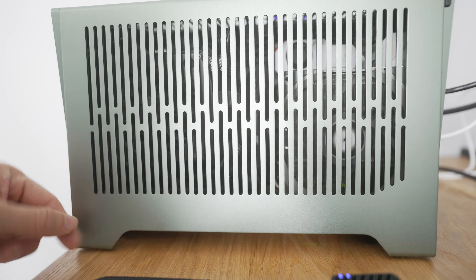I wanted to match the noise level from the Big Shuriken 3 in the Fractal Terra to test these two coolers, so this is a noise-normalized test with the panel closed. These tests utilize a Blender render with the CPU running on PBO — both with a curve optimizer and frequency-boosted setting, as well as an out-of-the-box setting. This should give the general user a better picture of which cooler performs better, since locking voltage down isn't how most users will run Ryzen 7000.